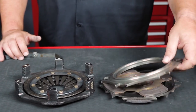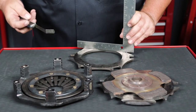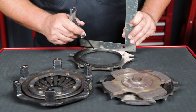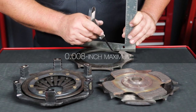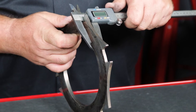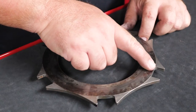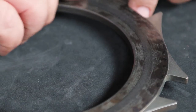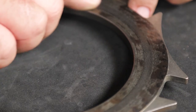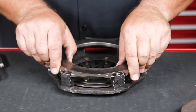Setting the cover aside, inspect the clutch stack. Start by taking the pressure plate off the stack and using a straight edge and feeler gauge, check for warping. Maximum allowable warping is 8 thousandths of an inch in any plate. Cerametallic clutch pressure plates can be resurfaced to a minimum thickness of 449 thousandths of an inch. Localized heat spots are harmless and can be ignored, but any small bits of friction material that may have welded themselves to the plate must be removed. Be sure to align the balance marks when reinstalling.